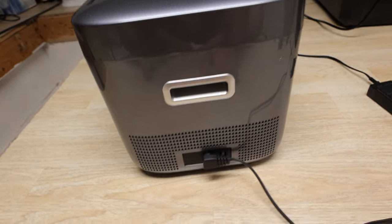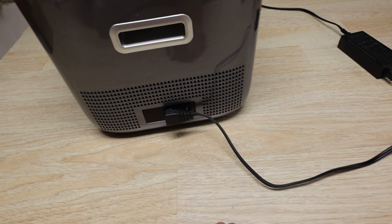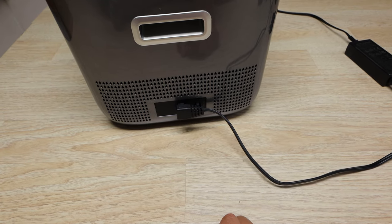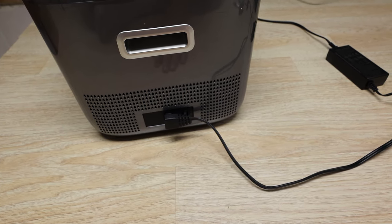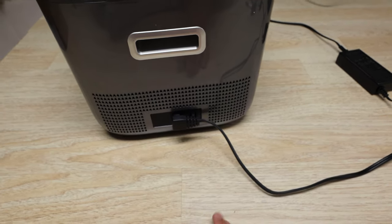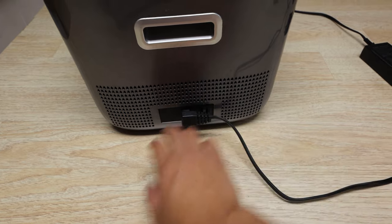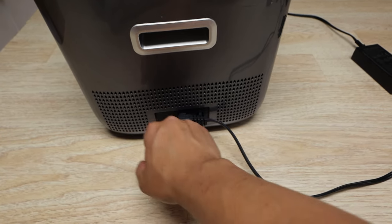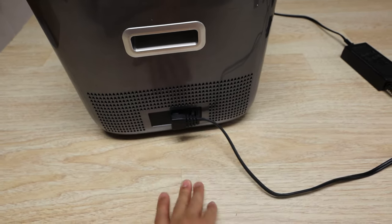Looking at the side of the unit, you can see the 12-volt wire going to the Goal Zero. I'm showing you this view so you can see there is a 15-amp fuse right there. So if you ever plan to go on a long trip, make sure you always have a few spare fuses just in case that ever pops. In the six months that I've owned this, I've never had that fuse pop, but it's always good to have peace of mind. You can also see it has ventilation holes for the compressor to breathe — keep in mind you need two to three inches of clearance on the sides and on the back wherever you put this fridge freezer.